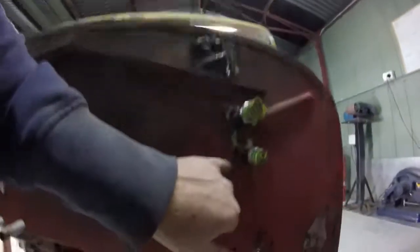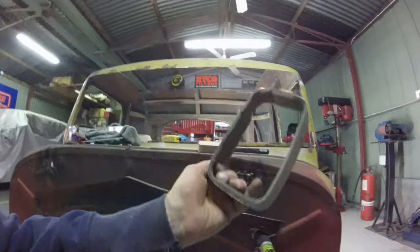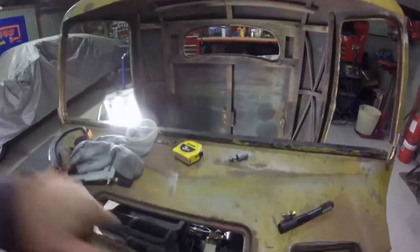The thing I'm really happy about is that all these components have gone in. I think cutting that square out in the firewall is definitely going to help. You can see where the original mounting plate was through that hole — at one time it sat flat on the Festiva firewall, but the Festiva firewall probably had humps and bumps. The closer I can bring that to the firewall the better, because it means I have to put less spacing in there. The little crush tube I put in to space it out — I can make that 20 mil shorter. I'm gonna have a go at this tomorrow — I don't think I've got anything to lose because I've already cut this out.